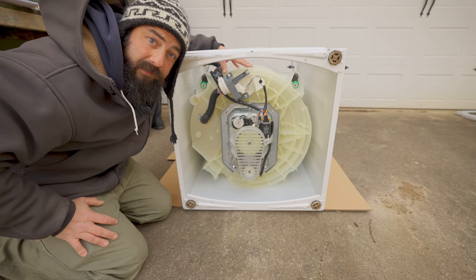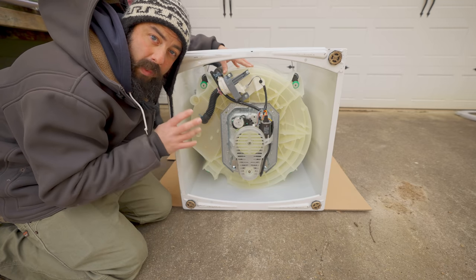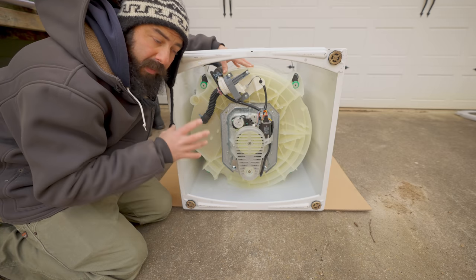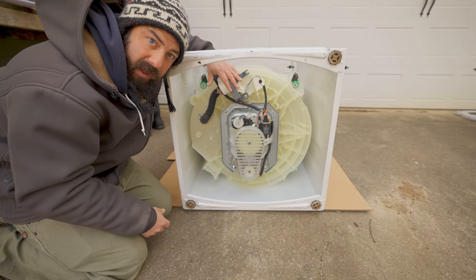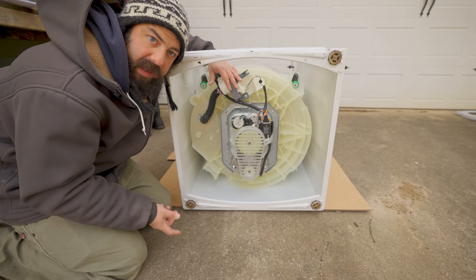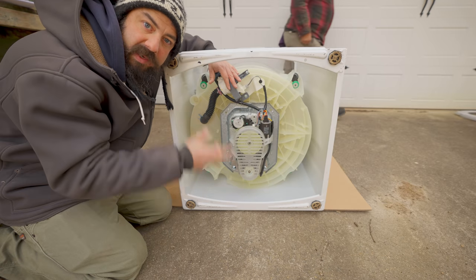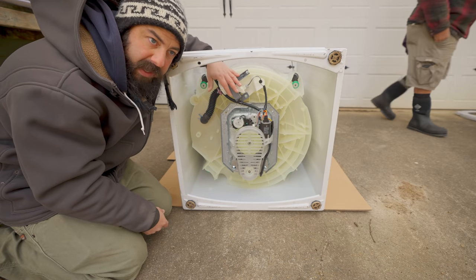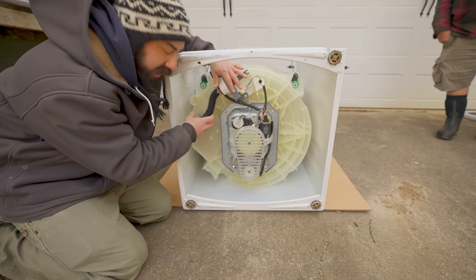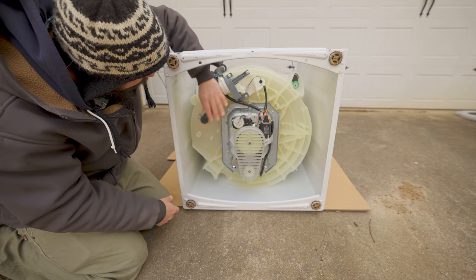We laid down the washing machine on the front of it, and now you're looking at the bottom. To give you an overview: we're going to wire the motor up separately just to spin it to dry the greens, but we need to take out a couple other things. One is the pump — when a washing machine normally runs, it pumps the water into the drain. Because we're wiring the motor directly, we're disabling the pump, removing it, and our drain will be a gravity system.